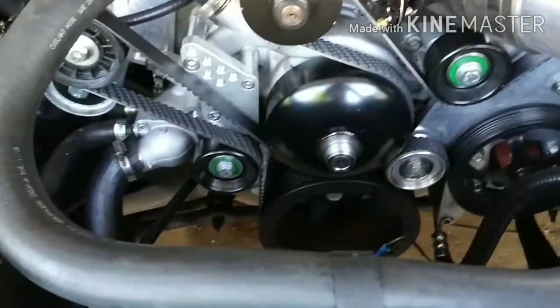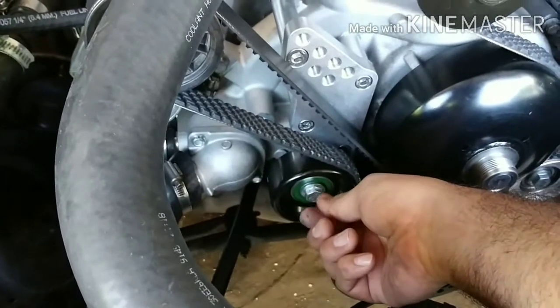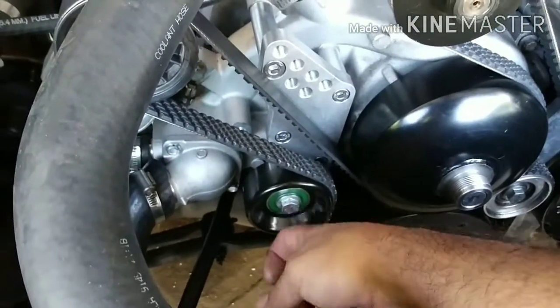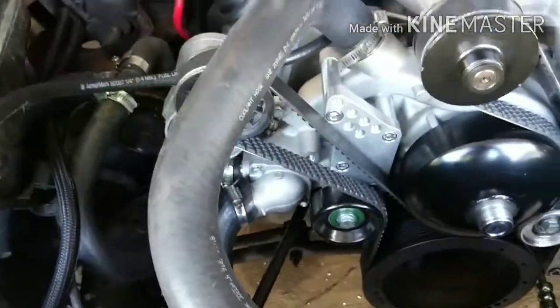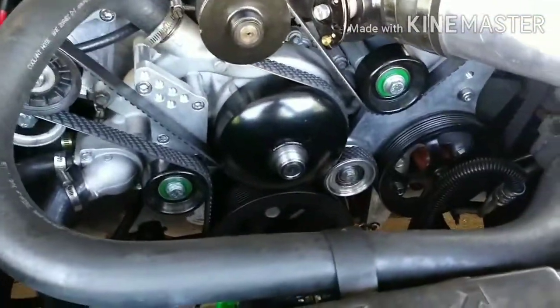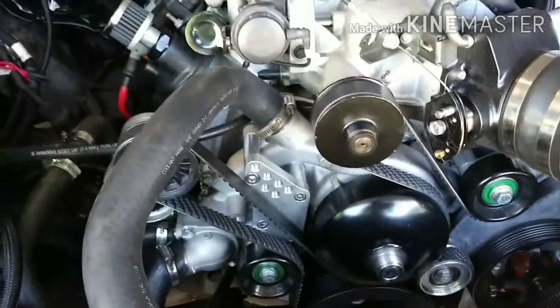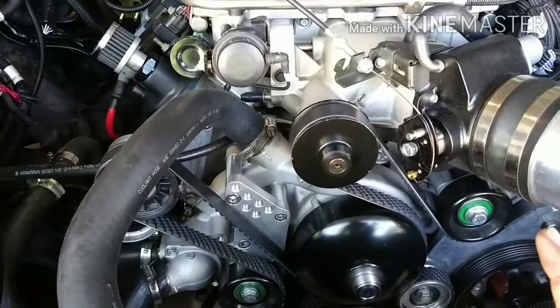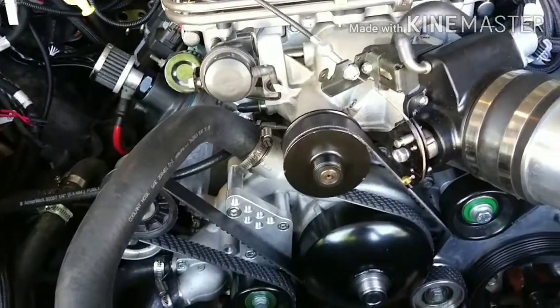But so far, they have a lot of adjustability. There are other threaded holes in here where you could put this pulley on to adjust for your different belt sizes. Heavy duty tensioner. It has multiple positions where you could put it on. If you guys do have this setup, a measurement that might help: my belt size is 111 inches.